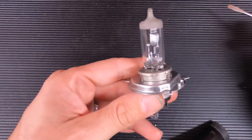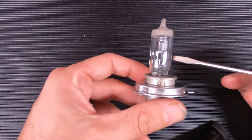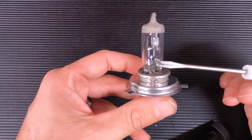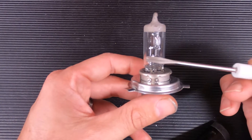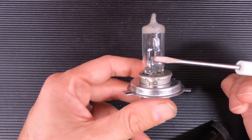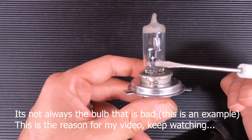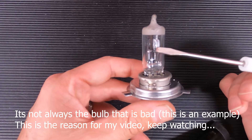So here is why that happens. We have a standard dual filament bulb and what you'll notice is that there's two sets of coils — one set that's lower and one set that's higher. So when your low beams are on, you've got your 12 volt circuit that goes through one set of coils and that illuminates, creating light. Now when this bulb goes bad, this coil itself typically disintegrates and blows, so power cannot flow through that anymore. That's why the bulb is dead.